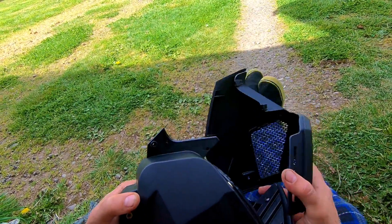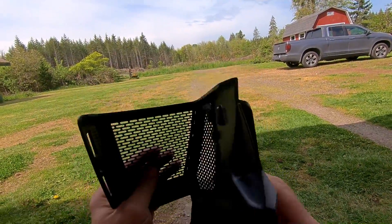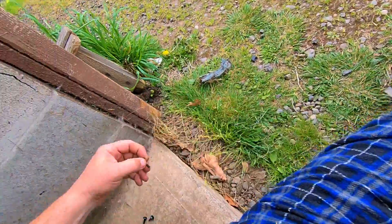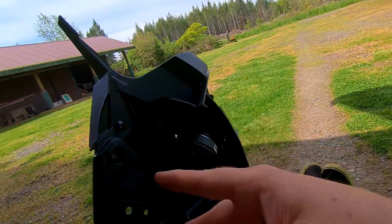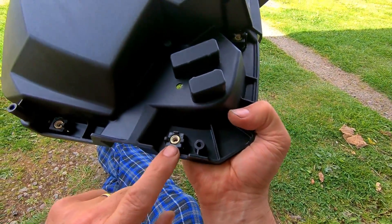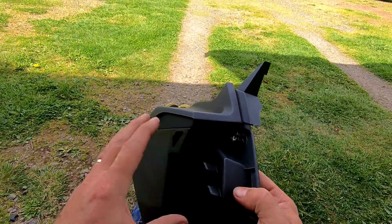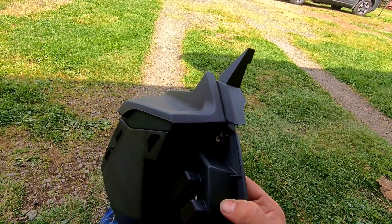This kind of just slides over and has a little locator nub. Notice you now have dual speaker grills — you used to have just the front one, now you've got one that faces the passenger too. These are just well nuts holding them in, so don't put pressure on them. The captured nuts I was telling you about — if when putting this back on the bike you push on those screws, it'll snap that nut out and it'll be rattling around inside. On 2017 and older, that nut ends up inside the seat cover and you have no hope of getting it out.